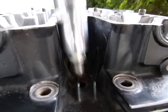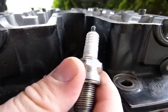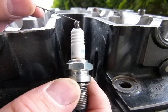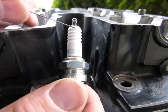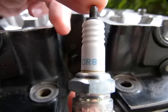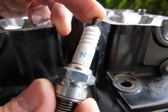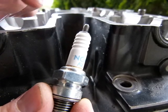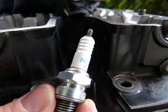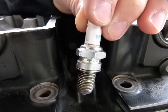Removal is fairly straightforward. You pull the spark plug out and that's what you have. The parts of the spark plug: on top you have a threaded portion — this is where electricity comes into the spark plug. Then you have the white part made of porcelain, like a porcelain tile on your bathroom wall. This should be free of cracks. Any kind of heat damage, pitting, and chipping should not be on it. Once it chips there is also dirt collecting in it, so it's fairly easy to see a dirt line since this part is white.